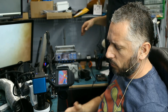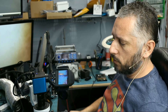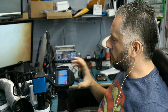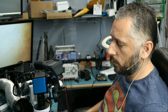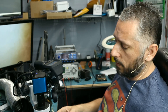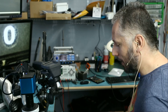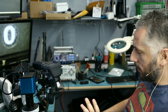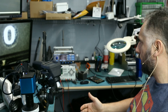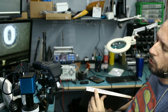At this point I'm just going to give up on the laptop. I do not know what's causing it. We spent enough time diagnosing everything — we're not able to see any short on the board even though the MOSFET shows short to ground. We applied voltage onto the shorted area and looked under the thermal camera, but still cannot find anything, and no amps are being drawn even applying five, six, seven volts. Right now I'm not able to figure it out. Looking at the mailing packages we have here — we have five HP Spectre x360 laptops that came in for exactly the same issue: no power or not charging. This is a major flaw with this model. I would not suggest anybody buying an HP Spectre.